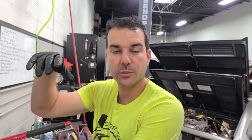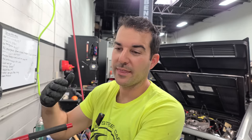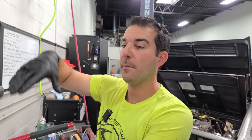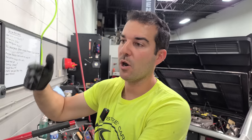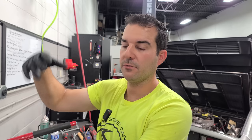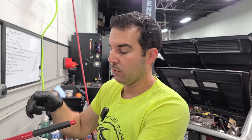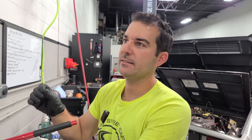That is electronic fuel injection, where the engine's computer is able to control each injector individually and only inject fuel when it's called upon due to the firing order. That's the most efficient. And before that, we had what's called batch fuel injection. So some cars would fire off one bank at a time or a group of cylinders at a time. So with that, you are left with some cylinders that are getting fuel when they don't need it, so a little bit less efficient. And then before that was this. So this is simultaneous.